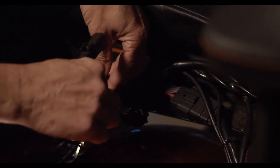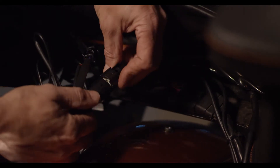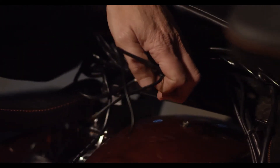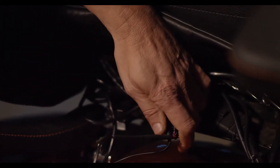If installing with our Magic Strobes LTP2, this tour pack converter must be installed downstream from the Magic Strobes LTP2 to allow the side arms to flash and strobe. Once you have the male and female connectors plugged into the tour pack harness, open the tour pack lid.